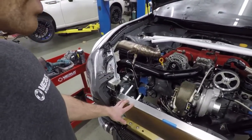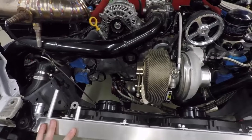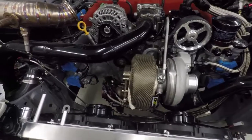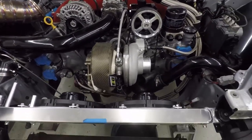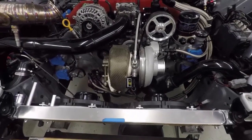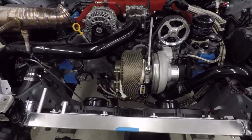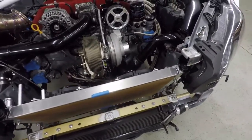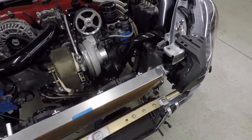We installed our high-performance radiator. As you can see, the fans actually fit with the turbo and the wastegate - Jeremy was pretty worried about that initially, but both fans fit. We're probably only going to run one fan for time attack to reduce weight and actually increase airflow through the core. This radiator uses a high-performance 27 millimeter Denso core and is specifically designed for motorsport use.